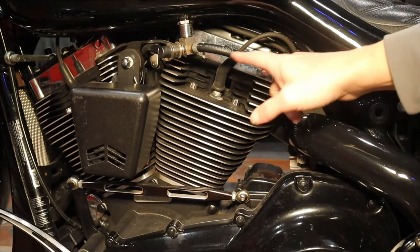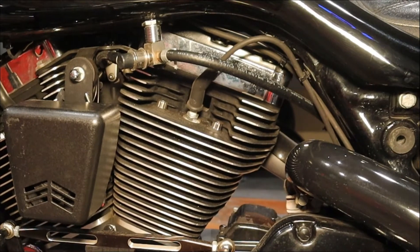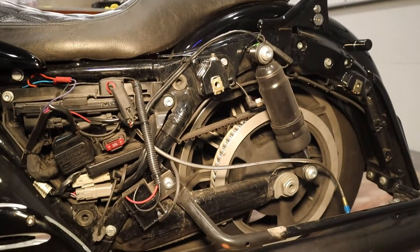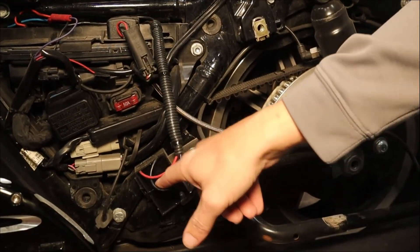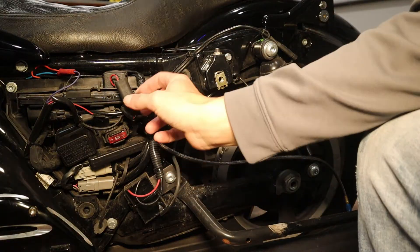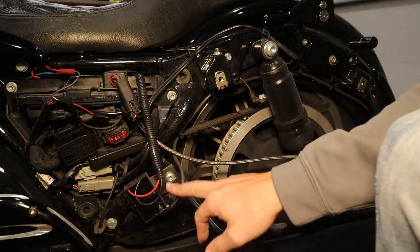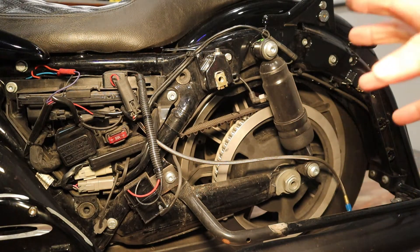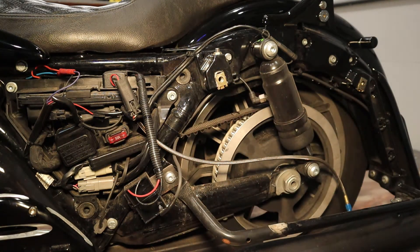Again, this is the fuel line. I'll pull off the other side in just a minute and show you the NOS solenoid, how I have that wired up heading back here. Again, you can kind of see the wiring here. I've got the igniter — this is from Hot Licks right here. I've got one on the other side that runs the other side, got it wired up nice in the loom. And then again, once you hit that horn button, it's going to ignite your spark plug and it's going to ignite your gas at the same time. So you do have to have the bike running because the pressure from the exhaust is going to blow it right out the back.